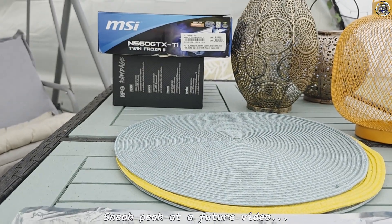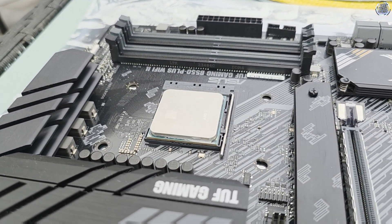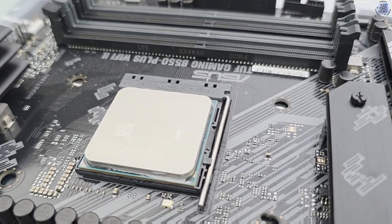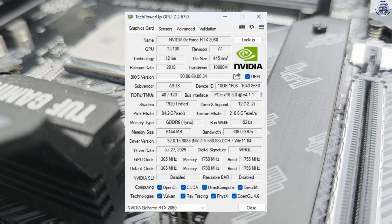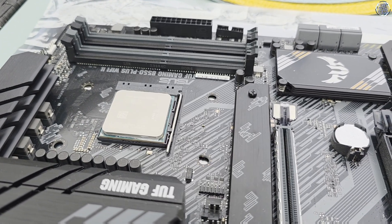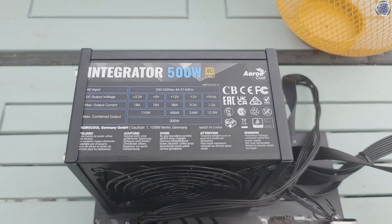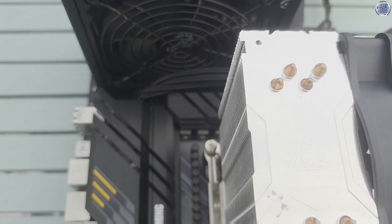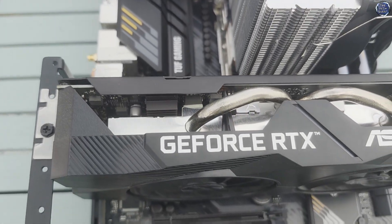Officially, the 3000G supports up to 2666MHz memory, but we've gone a little further here — we've put in 32GB of RAM running at 3200MHz, and it's absolutely fine. For the graphics card, we've gone overboard on that too. I've paired up the RTX 2060 for today's testing with the Athlon, a card you'll be seeing more of here as I plan on using it in lowest-spec builds in future videos. It features 6GB of VRAM and it's a nice little card with decent performance. The slight downside is that we are limited to PCIe 3 x4, as even when disabled, the Athlon's iGPU takes up four available PCIe lanes — it'll have some effect on performance, but there's not really a lot we can do here as this is a CPU limitation.